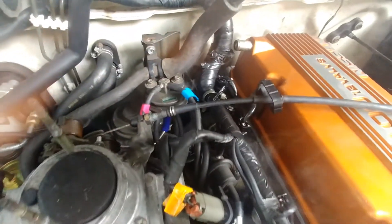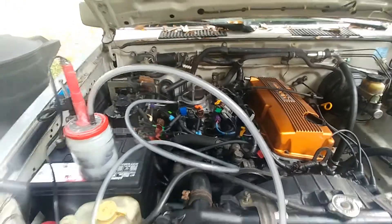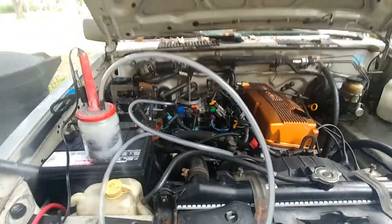I don't even need the smoke to notice that leak because if I set this up without the smoke I can actually hear the air coming out of there — I have one big gaping hole. Smoke coming from over here, smoke coming from over here. If you have any leaks, this is a really good way to find them. There you have it — I found my vacuum leaks, and you can too. Hope this helps.